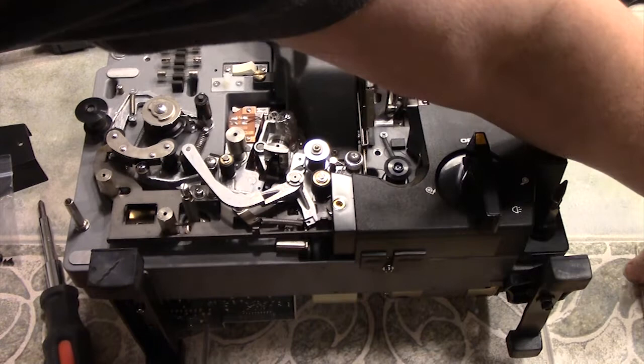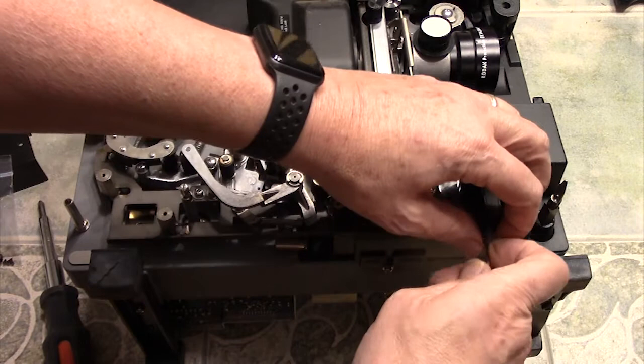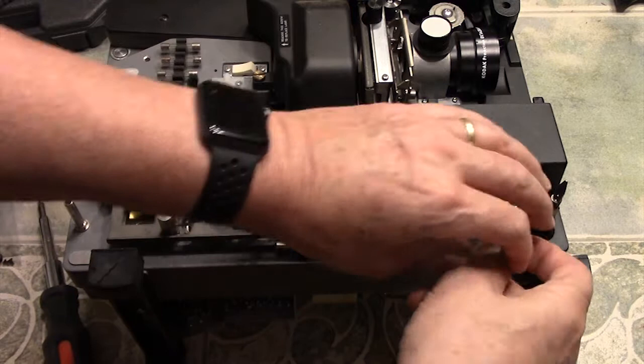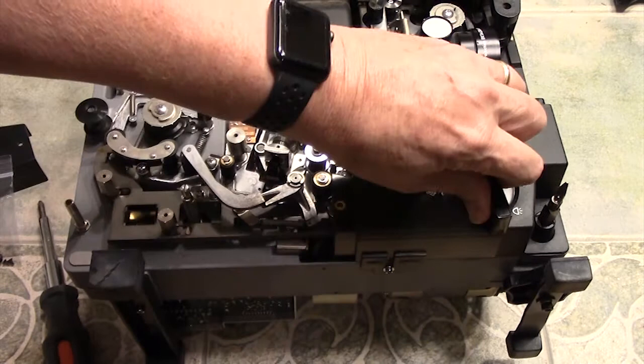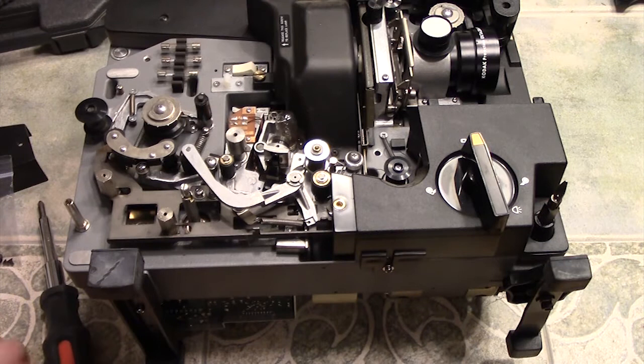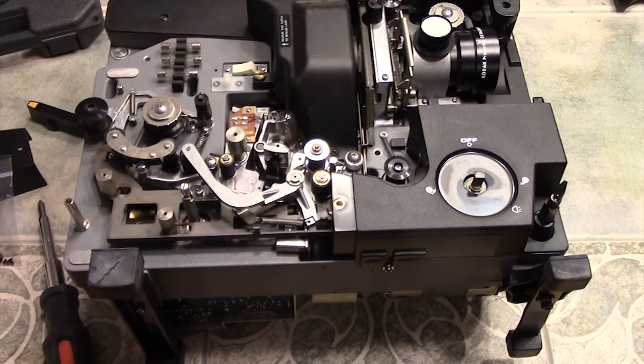This knob also comes off — you need a 2.5mm hex key, and they can be pretty tight so you might need pliers. I've had this one off before, so just twist it a little bit. You don't want to twist it too much, because you want to be able to use the button even when it's not tight. And you should turn it off and unplug it before you do that. So there — that's unplugged.